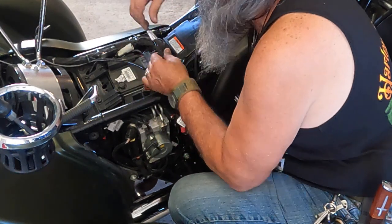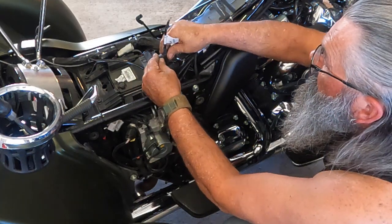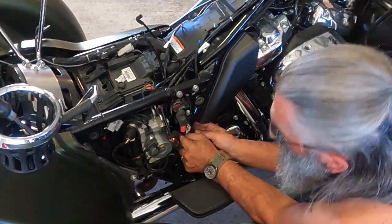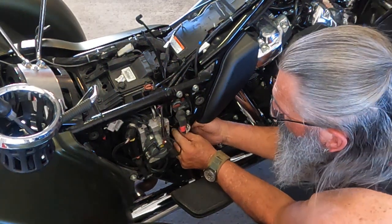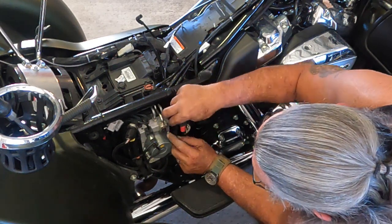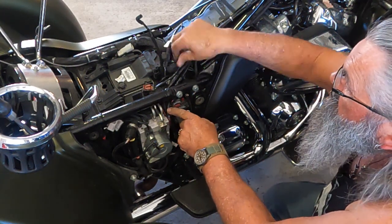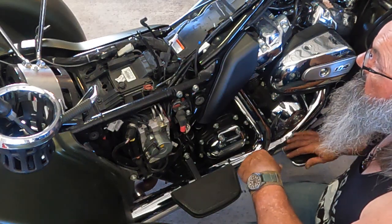Got that fed through — I'm going to pull the ECU out and lift the battery cover out of the way to get this attached. I might want to consider pulling off this dead socket just like so — that'll give a little bit more room in here. There's the dead socket that was on the original cable, and that'll give us room to tuck that one out of the way. There is where we're going to connect our heated grip power cord, and this is going to go over to the positive on the battery.